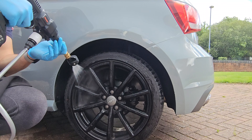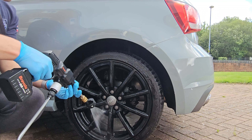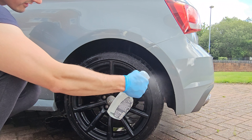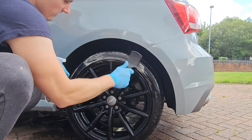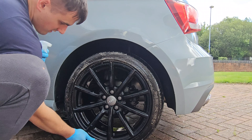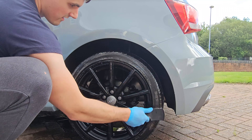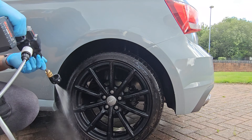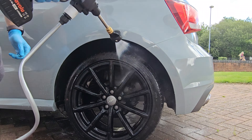Applying on a wet wheel doesn't really make much difference. Prior to using an acid wheel cleaner, I recommend checking the condition of your wheel. If your lacquer finish or clear coat is peeling off, you don't want to use it — if it gets on bare metal it will flash, oxidize, and potentially ruin the look. It's absolutely safe on clear coat.